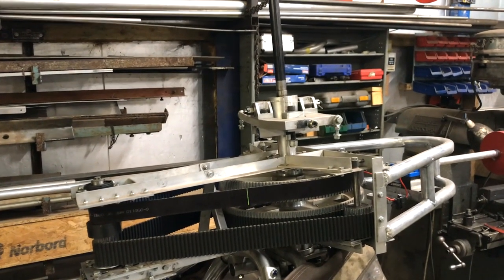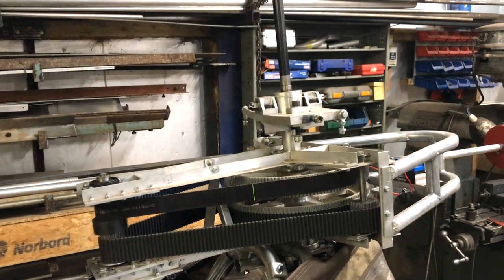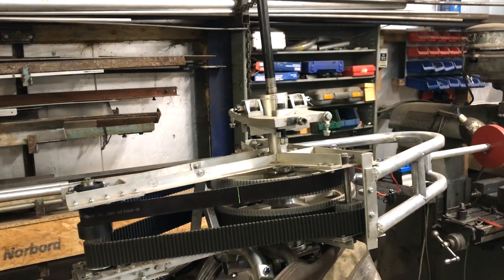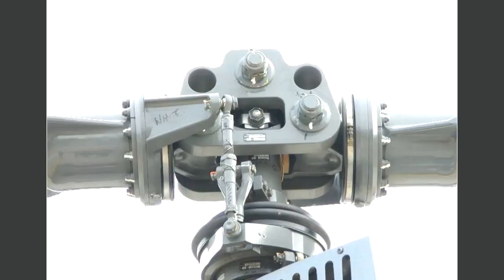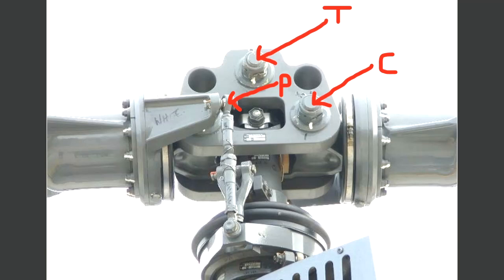There is actually Delta III built into rotor heads. If we look at the R22, it also has a Delta III hinge, but it's not recognisable unless you know what you're looking for. Here is a picture of a Robinson R22 rotor head. Here is the teeter hinge. This is the coning hinge. And here we have the blade pitch link. If we look at the axis of both the teeter hinge and coning hinge, we can see that neither line up with the pitch link. This means that when the rotor teeters or flaps, the blade will change pitch or feather, in the same way that the previously mentioned Delta III rotor hinge works.